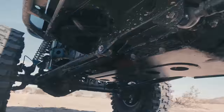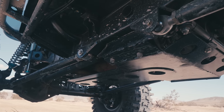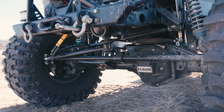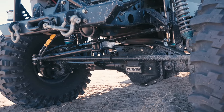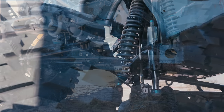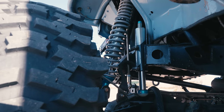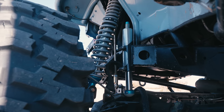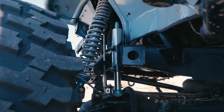And you are three-linked on this thing, and your third link is on the passenger side. Yes, to clear the driveline and get around the drivetrain. And that isn't easy to make everything fit, because this is an FJ40 frame. You have 27-inch center-to-center. So getting the steering box mounted in here, track bar to clear, everything going on, and you still have up travel. Looks like you have about 5 inches of up travel. Yep, that's about what I set it at. Four and a half to five, depending on where I'm at. Currently on King 2.0 shocks, soon to be 2.5. And these are 14-inch travel? 14-inch, all the way around.